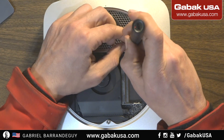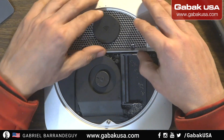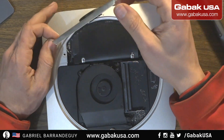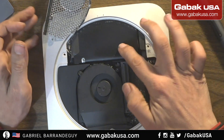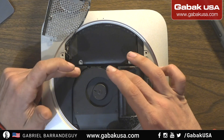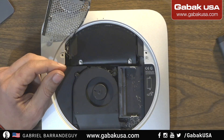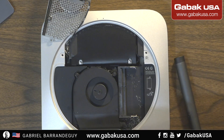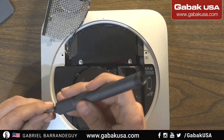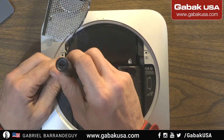After that we are going to remove this screw that you see here, and the hard drive should be here. There you go — there you have the old drive. So in order to make some space we are going to remove this. You could have done this before, but if you don't know if the unit has an old hard drive or just an SSD, you can do that.